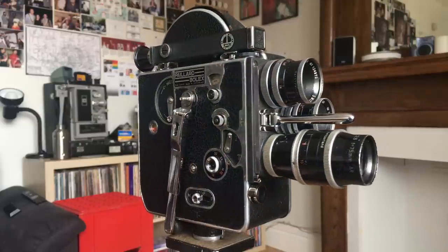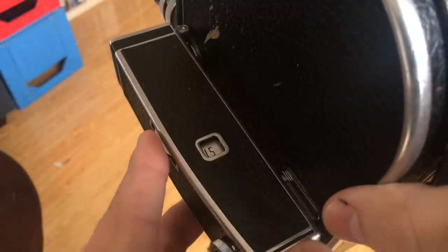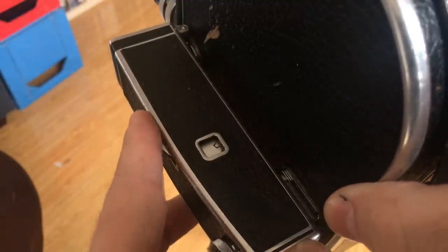Spring-driven cameras like these are also typically non-sync cameras, so they don't run precisely enough to sync up audio with the picture. Certain cameras have the ability to run at precise sync speeds, and those are usually much more expensive, or certain later Bolex models have sync speed motors that can be attached. Those motors take extra power sources and run the camera very precisely. One of the big differences between models is reflex versus non-reflex. Non-reflex means you're looking through a viewfinder that gives an approximation of what your lens is seeing. Reflex means you're actually looking through the shooting lens. This is a non-reflex model — the viewfinder at the top is disconnected from the body and in order to expose onto the film the lens needs to be in the middle position. My camera has a secondary viewfinder on the side to emulate the lens I'm shooting with.